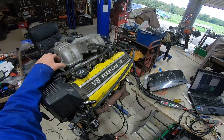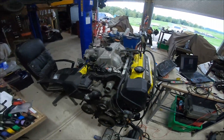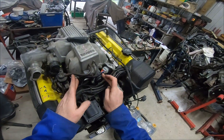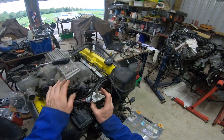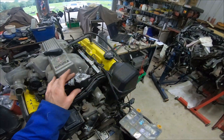So what we've got here is my favourite Lexus. The stepper motor is located on the front of the engine — that's the idle speed control. The one that's on this engine is a later model one, but I've got an early model one here for the demonstration so we can actually see that pintle moving.